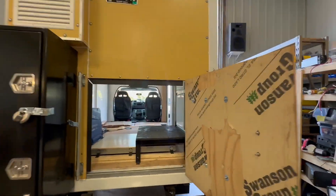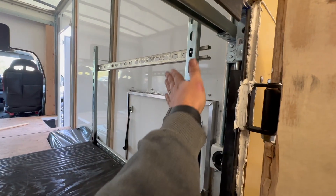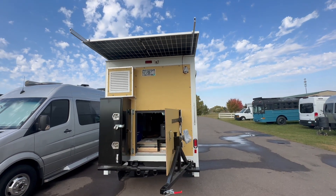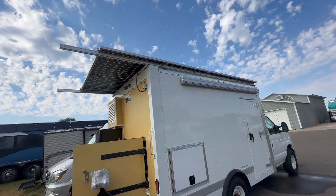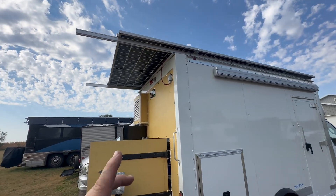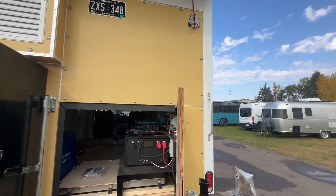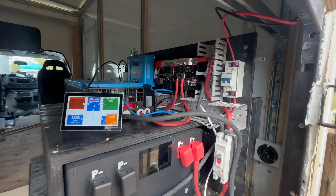Here is the box truck. The battery is going to sit here, and the board will be right there. It's been a couple of days and we've been hard at work. We've got four of these giant 500-watt panels on this little box truck. We've got solar running, it's all wired up, and it's working. We have our board installed. We've got some raceway covers and other covers to put on, but I figured I'd show you a little bit of work in progress. We do have our screen going, and the battery is fully assembled and working.